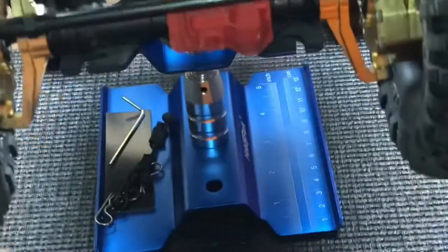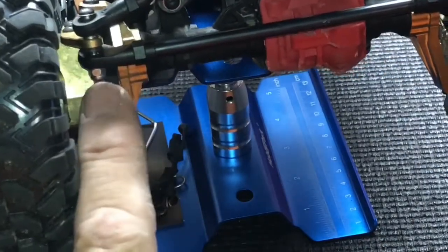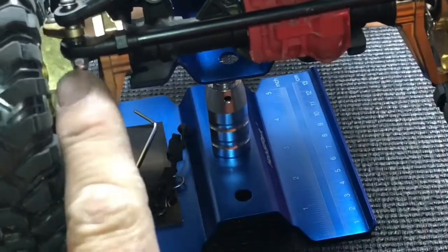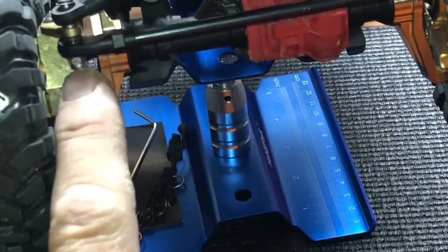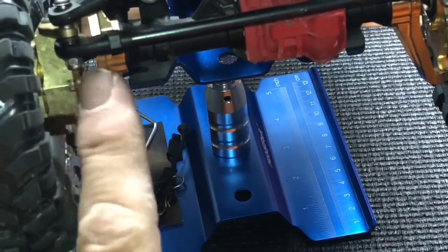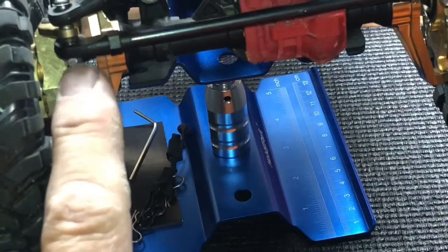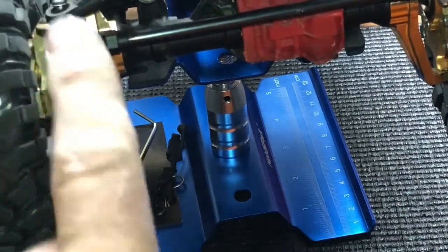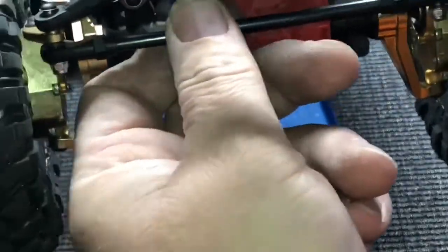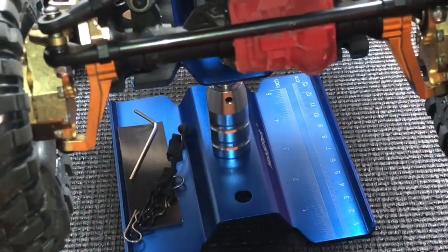So, and then I put everything back here. And then when I put this bolt back on, I did put Loctite back on it because they're, I don't know, we used to call them airplane nuts, but they got the rubber washer on the inside so it locks in. But it's just a couple threads on, just past it. So I like to throw a little Loctite on those. Plus you get a lot of movement with your steering and stuff. So I throw Loctite on those.